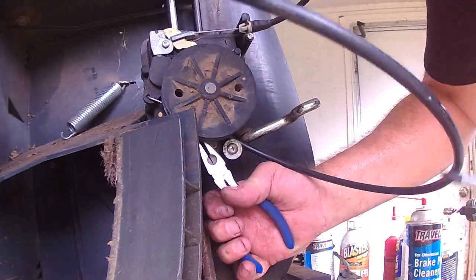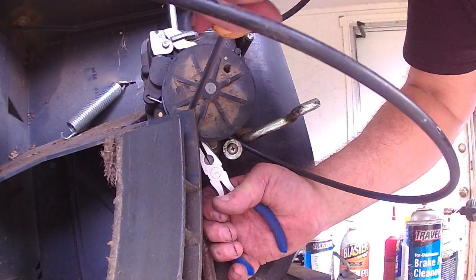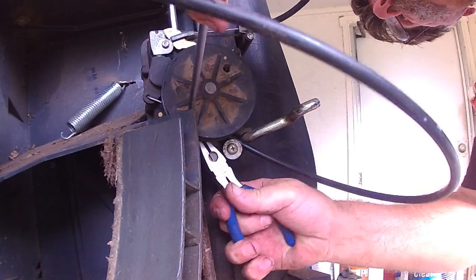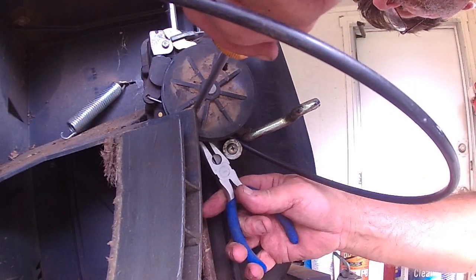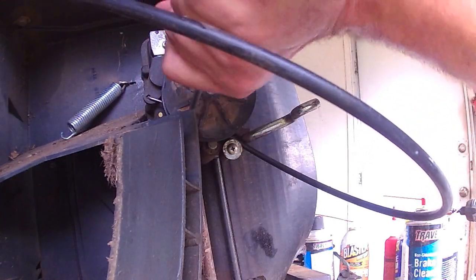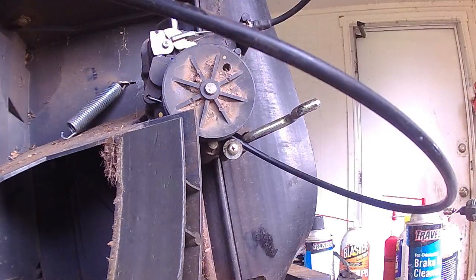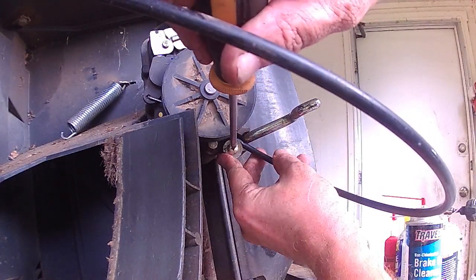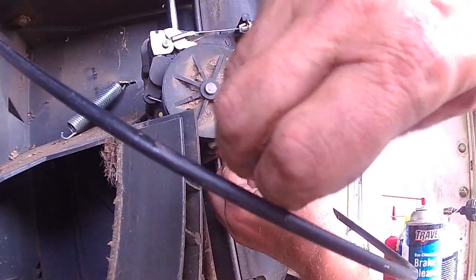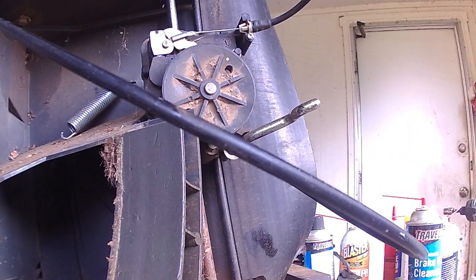Go in with a pair of needle nose pliers to help hold and twist the screw into place. Get that tightened down — remember you're putting a steel screw into plastic. Then loosen this up, readjust your washer, and snug it back up. Then reassemble your transmission, which has already been covered in another video.